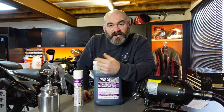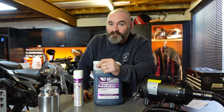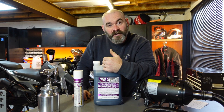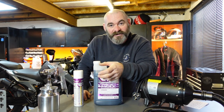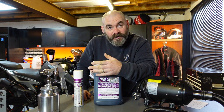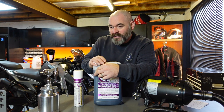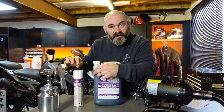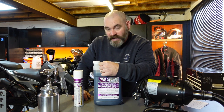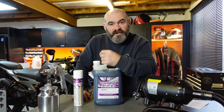Basically, you need to clean your bike, really clean it well, give it its birthday clean. You don't want to spray ACF50 onto grime, you want to spray it onto metal. So you need to get the metal as clean as you possibly can. Remove as many of the panels on your bike as you can that are hiding metal parts. So take belly pans off, take chain guards off, etc, just to expose as much of the bike as possible. And then, once the bike is completely clean and dry, it's basically just sprayed on.